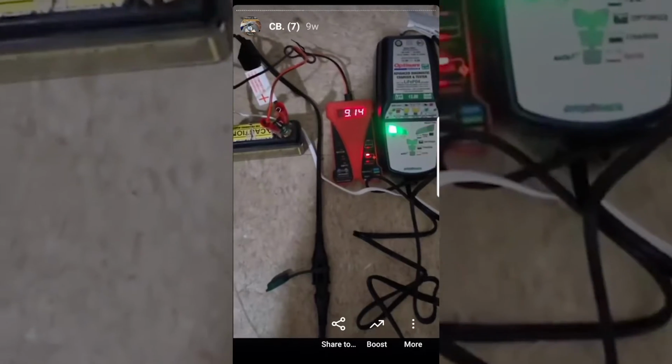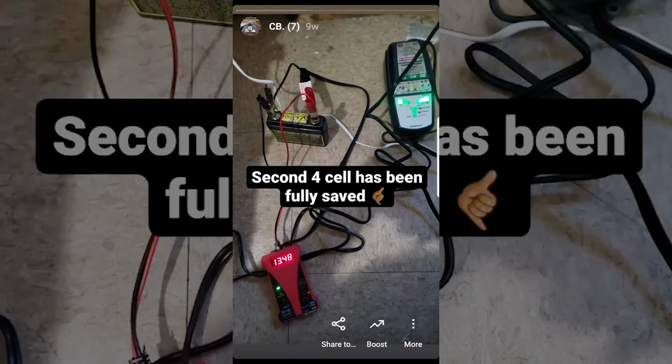These are so lightweight that I could carry them around as spares if need be. For the first days of correctly cold starting a bike, I would tend to go overboard with the kickstart pumping, but the more and more I did it, the fewer kicks I would give, to see what the minimum amount is needed. And pumping the kickstart is also good because you're creating oil pressure.